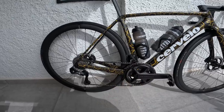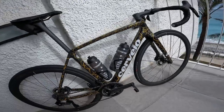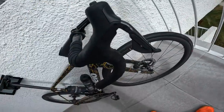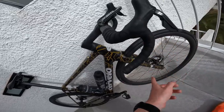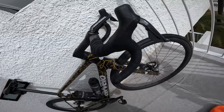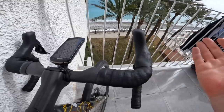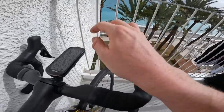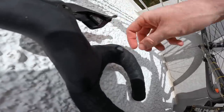I think a compact setup for anything that's climbing is great — I am a big fan. Some of the things I really like about the 12-speed groupset are the shifters more than anything. The shape is so much more ergonomic than the previous generation, and the braking feels a lot more responsive. They've taken some of the technology that was in the GRX groupset brakes and brought it into these shifters as well. They kind of slightly curve inwards, which feels nicer to hold. You have the top buttons here as well, which you can set up for shifting — these two buttons shift through the rear mech. And I have sprint shifters here which will also allow you to change the rear mech.